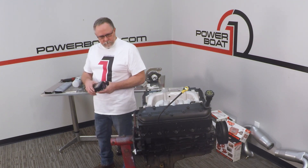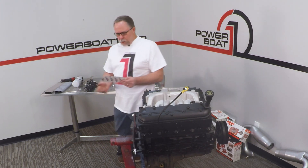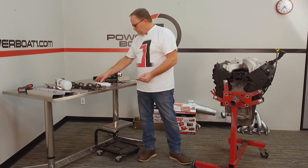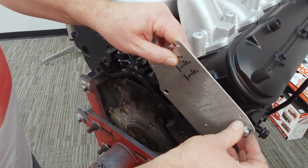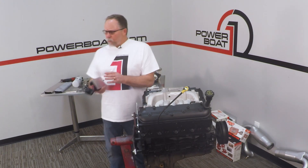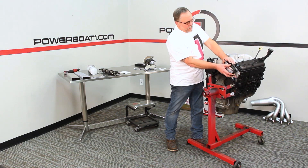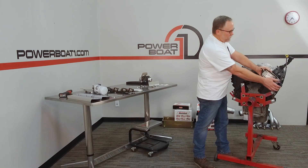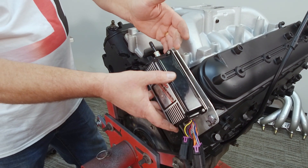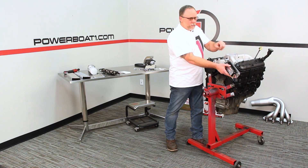For our LS control box, we're going to mount it up on the back of the head right here. Same thing — with a little cardboard template, set it up where it's going to bolt through where the box is going to mount, then made a little aluminum plate that'll just bolt onto the back of the head. You tighten that down and then we'll use the little rubber mounts that come with the MSD box — they'll attach into the four holes here and then the box will set on the rubber mounts and the screws will go in to hold the box in place. One of these plugs fires the cam sensor and the crank sensor, and then the other one does the coils, which is basically your ignition system. That's where it'll sit, and then we'll have the little relay for it that's required — we'll bolt that off the back and show that during the wiring application.